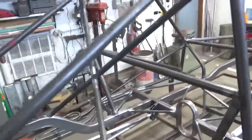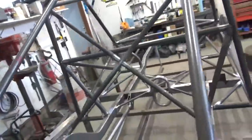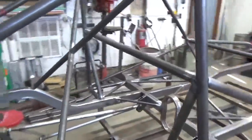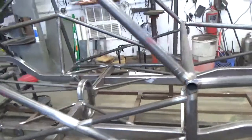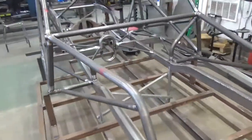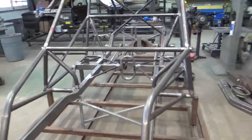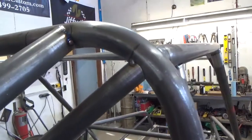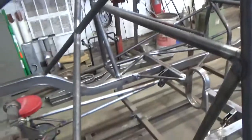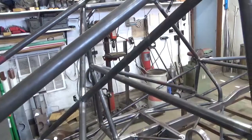This is the Henry J. We've got the X in here. If you look at it from the back, it looks straight from the back, and it's the same on this plane here. The door bars are the same way. This car has pretty much all the main tubing in it. The whole purpose of the X in the back is to help pull the roll cage up and put a little more diagonal support in here. Triangles are stronger than rectangles, so you've got two triangles butted against each other in theory.